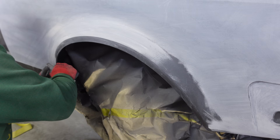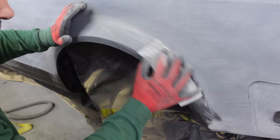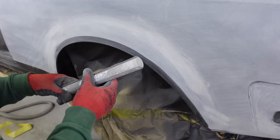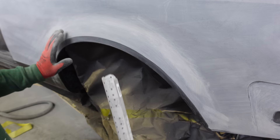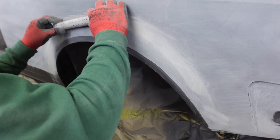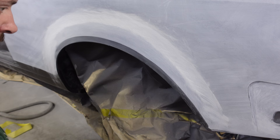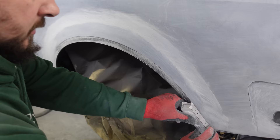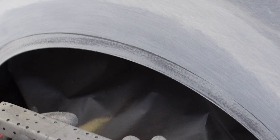We're going to start on this flat here using this small Dura block - it's very bendy so it'll bend with the curve. Just going backwards and forth like this, keeping an eye on it making sure there's no low spots anywhere, and also keeping an eye on this edge not to overwork it, trying to keep it consistent and smooth. This line tends to just fade away - it was the same on the other Lotus, so I'm guessing that's how it's supposed to be. A bit of an odd thing this car really.